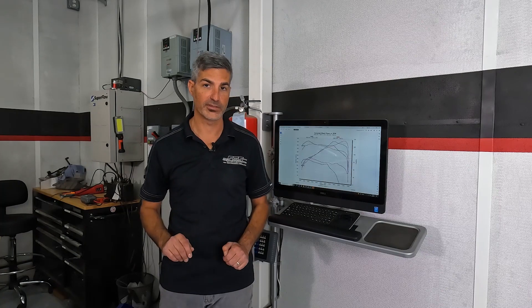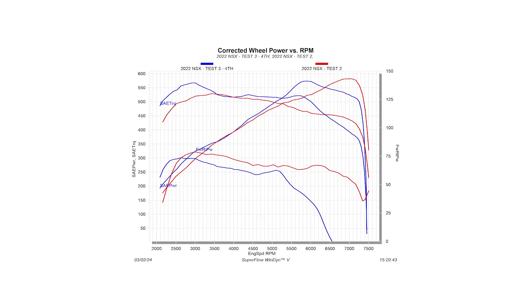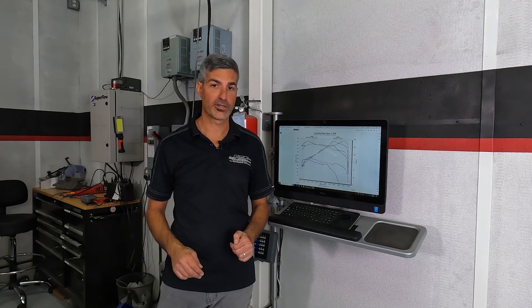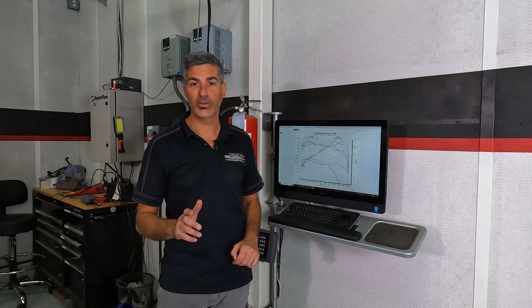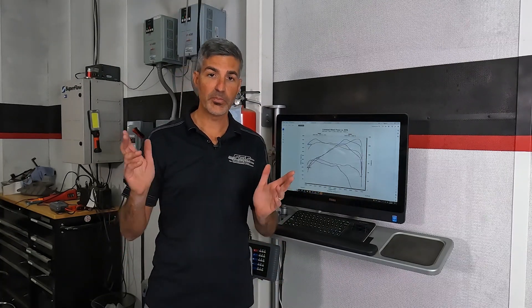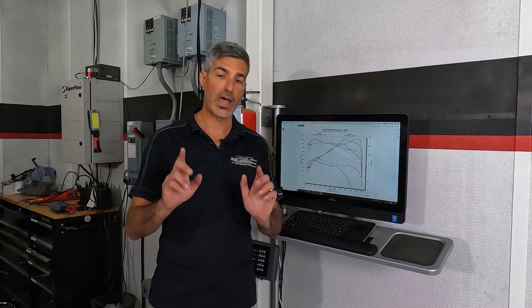Compared to other non-hybrid vehicles, this electrified NSX adds a whole new dimension which really complicates producing accurate results, and that is the electric motor output. This is illustrated by reviewing third and fourth gear tests. As you can see in the graph, the output is drastically different between third gear in red and fourth gear in blue. This is because in fourth gear at 5500 RPM and in later gears, motor output drastically diminishes. In the past, Science of Speed published in fourth gear, but recently we switched to third gear so that the power curve shape isn't influenced by the motor output decreasing. It results in graphs that better illustrate the output of the engine.